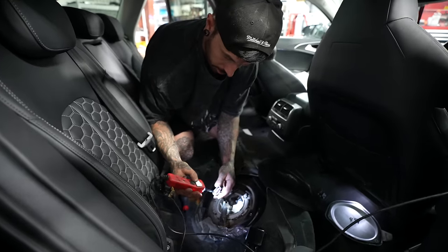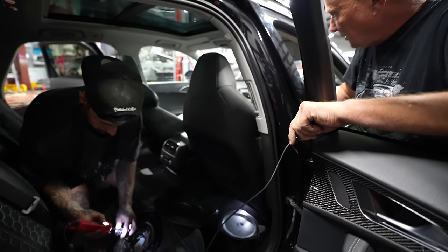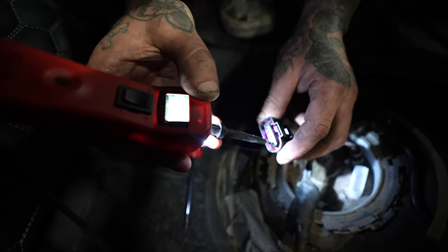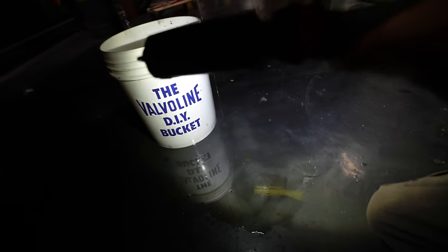I took the connector off and my dad turned the ignition on. Then I was trying to figure out which one of the wires was the 12 volt wire sending power to the low pressure fuel pump. But I couldn't find any of them that were 12 volt and I didn't want to risk sending power to the wrong one and blowing something out. So plan C arose, which was to knock the fuel filter off and just siphon it out of the tank that way.